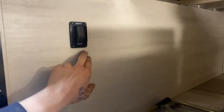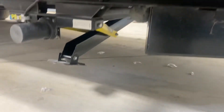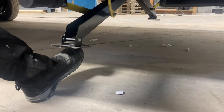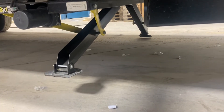Up on the wall back here, you've got your stabilizer jack switch — press and hold extend and you'll find the stabilizers come down. Now these are not levelers, they're just stabilizers. You can see if I put my foot underneath it the other side still goes, so it'll equalize itself out on your campsite. You want your trailer about as level as possible before you bring them down.